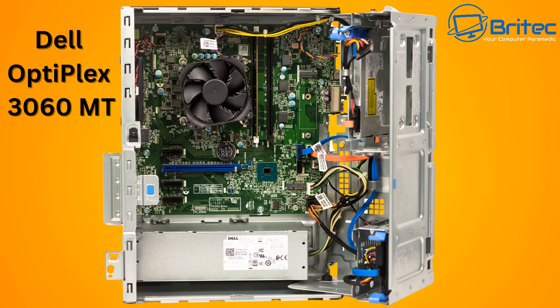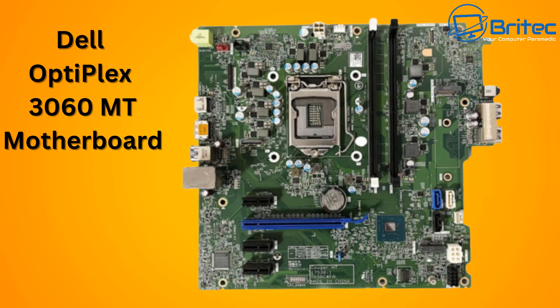You may be thinking you can just remove the motherboard and put it into a nice modern case with some RGB. But as you can see, it is a proprietary motherboard. On a lot of these systems from Dell, HP, and Lenovo, they have their own custom board. The standoff positions are not the same as a standard micro-ATX motherboard, so they're not going to fit into a standard case — you might only get two or three screws in.